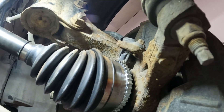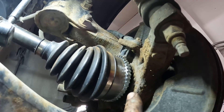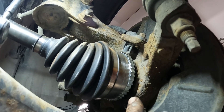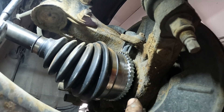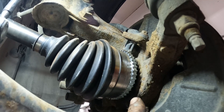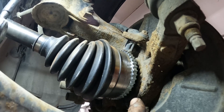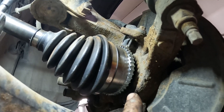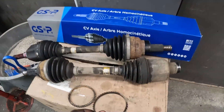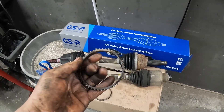But on these Fords, you'll notice the ring is on the axle. So what can happen on these — and it happens all the time — is they'll develop a bit of rust underneath the ring. The axle itself will rust and it will split these rings.